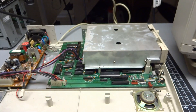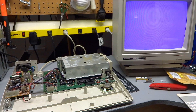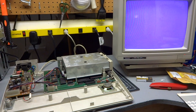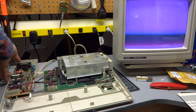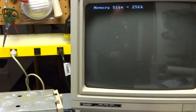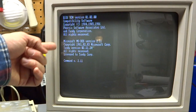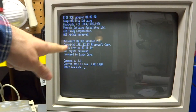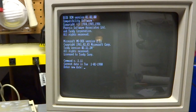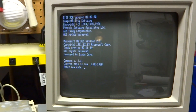If you need to use a regular floppy drive in a Tandy, change that jumper to the other position. Here we are with the floppy drive connected. I have an MS-DOS floppy installed — let's turn this on. The seek sounds good, and there we go: MS-DOS 2.11, copyright 1983, Tandy version 2.11.24, licensed to Tandy Corp. There is no real-time clock in this computer because it's basically like an IBM XT — it has an 8088-2 processor, so you do have to set the clock every time you boot it. But great, it booted up.